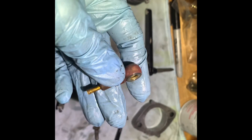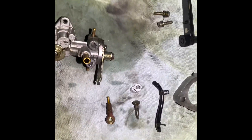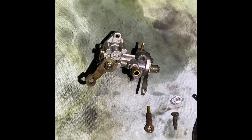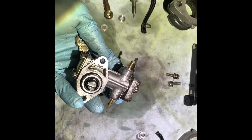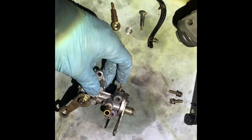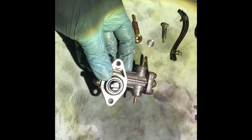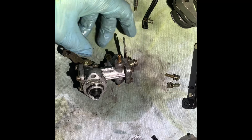You really have to make sure all these are clean because if you're not getting oil to your engine it's going to blow up. For the first couple starts when I get the new pistons in and everything, I'm going to be pre-mixing my gas first because I don't want to take the chance of blowing another motor if it's not getting oil. I'm going to get this set up to prime — I'll tape a socket to the end or use a drill with a flat head, spin it, and see if it's pumping oil.